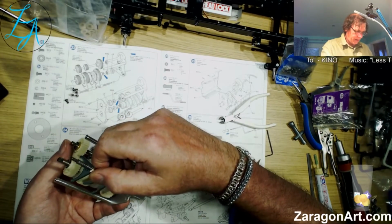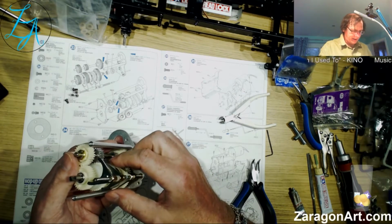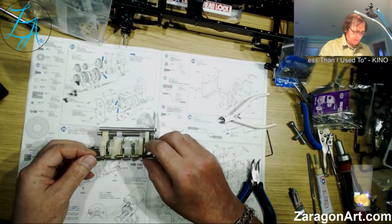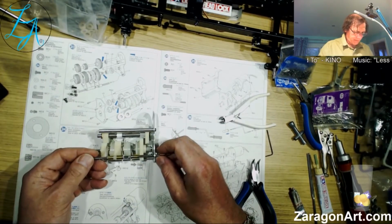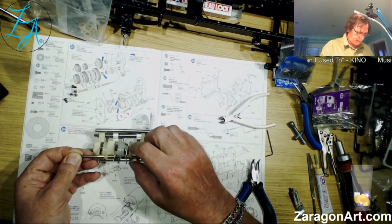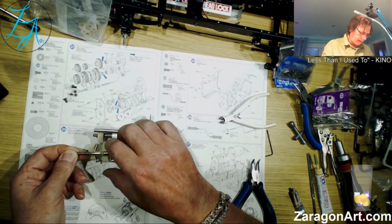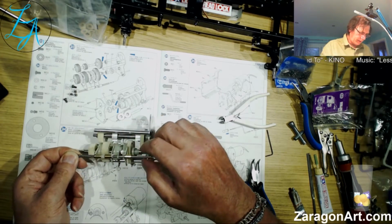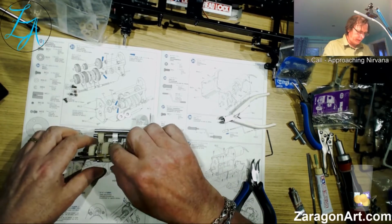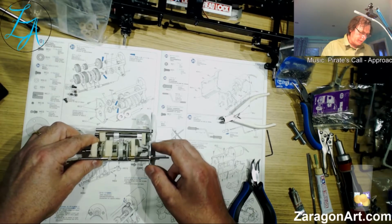Now that goes in there, and I've got to make sure that these selectors slide it that way. Okay, take the gear out, gear shaft out. So that one won't move. That has to go there, and that has to. These forks here have to go into the slidey bits of those gears. So it looks like I've got to do this two pieces at one go.